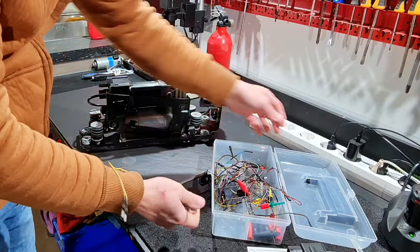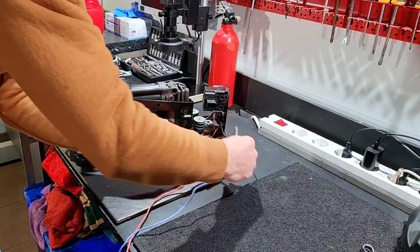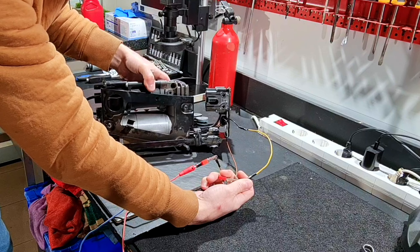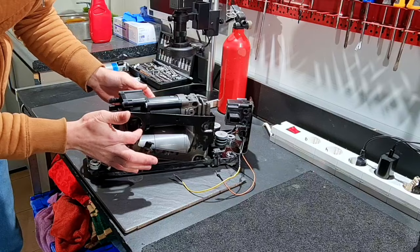I will need two pins. This is the plug for the electric motor — here I have a 12-volt battery connected, plus and minus. The electric motor is very quiet; that is good. But you can hear the air is being discharged. So at this moment I think the discharge valve has a problem.